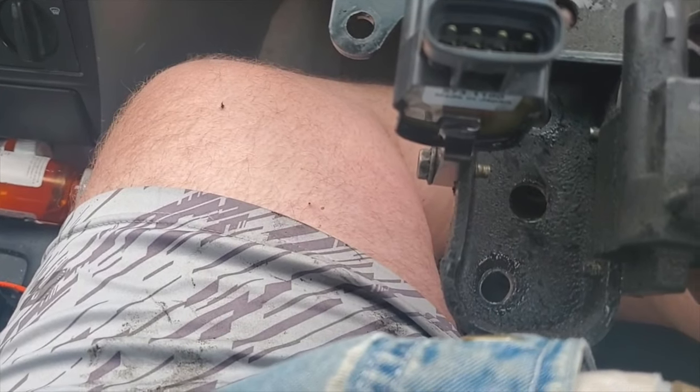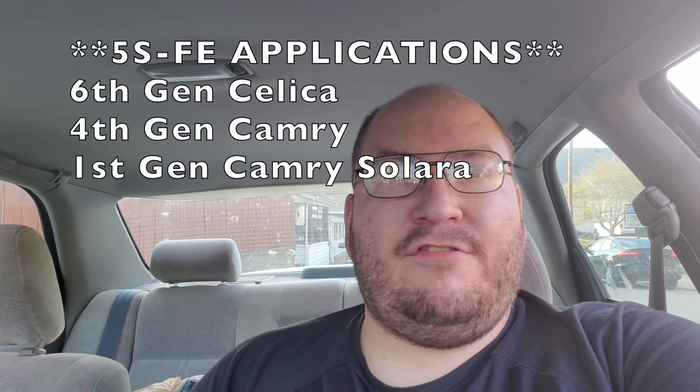Thanks for watching. So that's pretty much it on how to mount some new ignition coils to your vehicle. This pretty much applies to any Toyota Camry or other 5S-FE with ignition coil packs — and I say that because other older 5S-FE engines, like Scotty Kilmer's legendary 1994 Celica, has a distributor rather than coils like on this engine. So keep that in mind. I think the oil leaked into the coil pack — that's probably my problem, but it's just a theory. It helps keep your engine running nice and smoothly. It's a little bit of a complicated process, but with aftermarket intakes like mine, you can get to the bolts easier without having to do any more unnecessary steps.